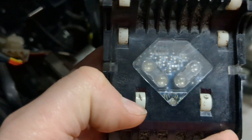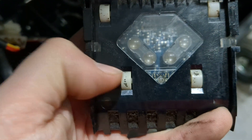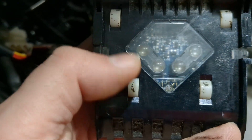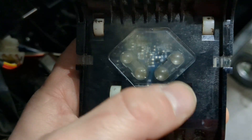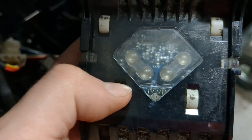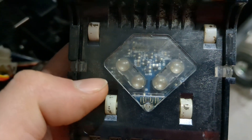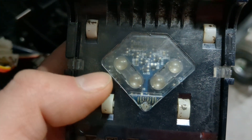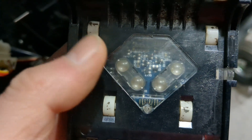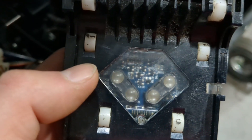Basically, spray the alcohol on it and use the wipes to wipe everything off. Have the wipe on your hand and use your fingernail to scrape that stuff off. You see how the bill goes in and rolls over those rollers? If those are covered in black dirt like they were here — and this is a very dirty place — the bill won't grip, so it just slides off and the machine won't accept it.